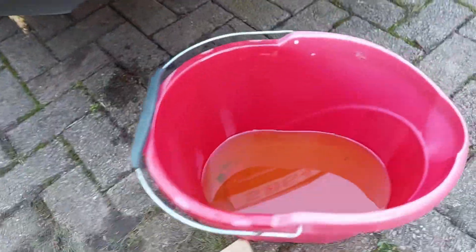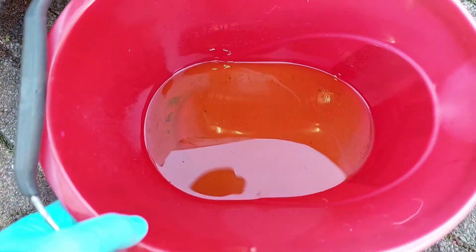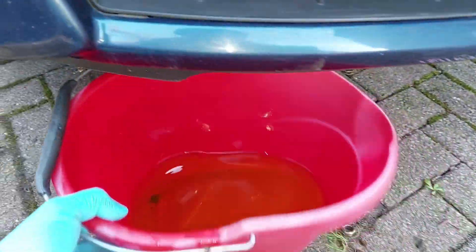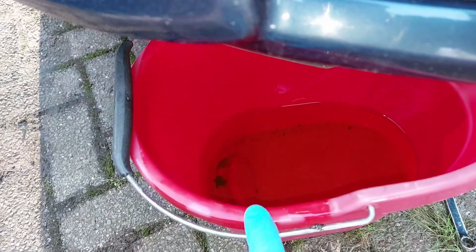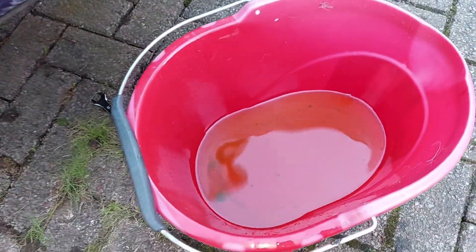I've been draining for about 20 minutes so far and if you look in there, it's lucky if it's three liters. The car's jacked up on one side so I'm going to have to lower the car down to get as much out as possible. This bucket is too tall once I lower it down and I can't use my washing up bowl because antifreeze is extremely poisonous - don't put it on the floor where animals can lick it. Don't get it in your mouth, eyes, or on your hands.